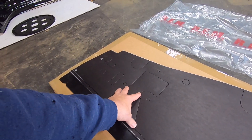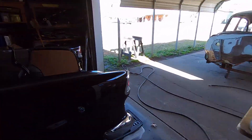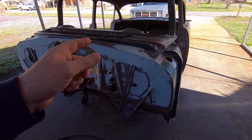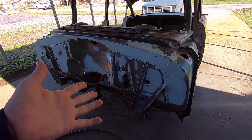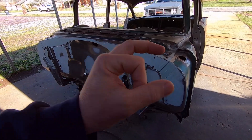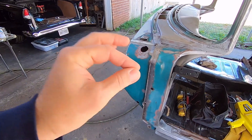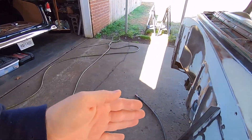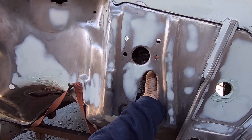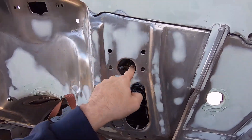I did a video on this a long time ago and I've done it to both cars. Where the holes are in the firewall, I replaced the clips with a 1/4-20 bolt — half inch would be ideal but I had three-quarter inch here, so I'll grind them down a little. I clean the cad plating off the head so you can get a good weld, draw a sharpie dot in the center of the bolt head, stick the bolt up through the firewall hole, line the dot up with the center of the hole, and weld it up. Then grind it smooth and you've got a clean firewall with a stud on the inside.